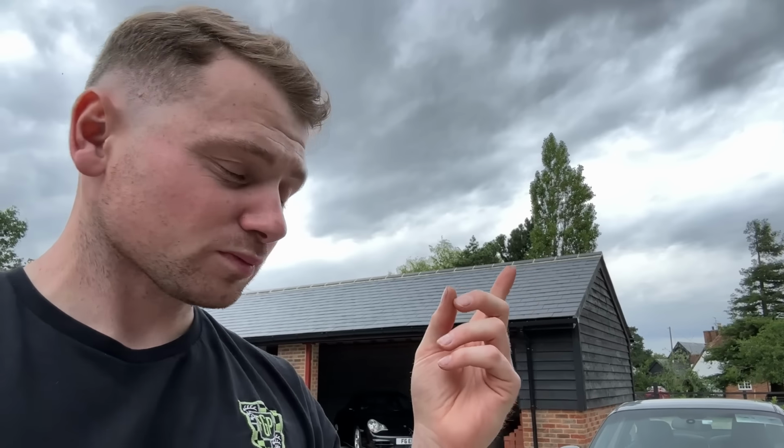That's usually, well, one of three things. One, it's just going to be AWOL and you can do a customer handover to the car on PWIS and it's fine. Two, the switch can play up. Or three, the most expensive option is the sunroof motor. There's micro switches in there and they play up. Unfortunately, it was the latter, so it's a new sunroof motor, about 45 minutes to an hour's labour, stripping that out and changing that, and £394 plus VAT for the motor.